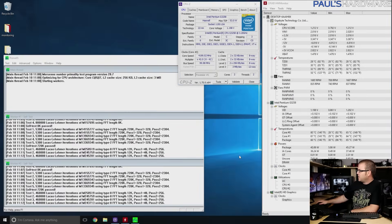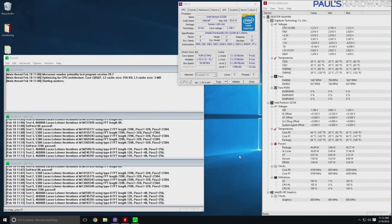I'm back — this has been running for about 12 minutes now and I'm happy with the results. Everything's staying within range. Temps did creep up a little bit more but we hit 64-65 degrees Celsius max, which is really not bad at all. Voltage is 1.2 or just over 1.2 — I didn't touch that in the BIOS and that's a perfectly acceptable voltage. It's been passing all the Prime95 tests just fine.